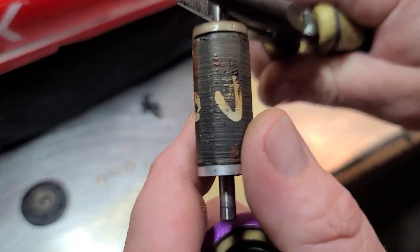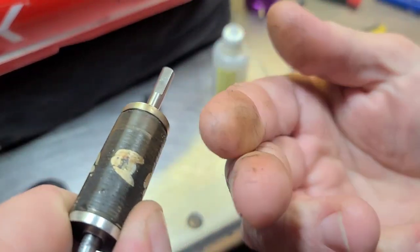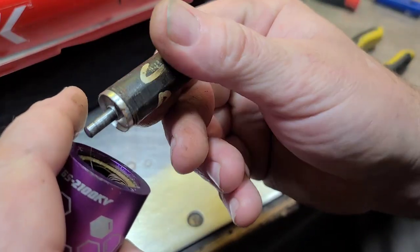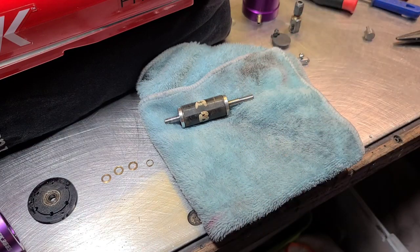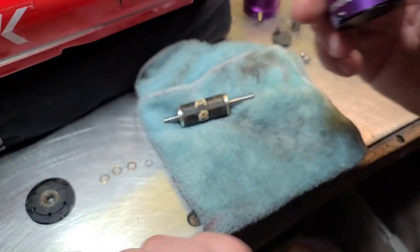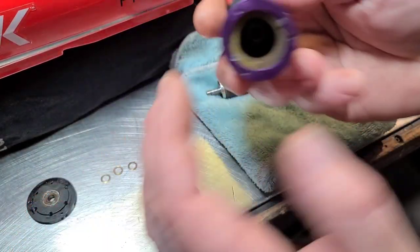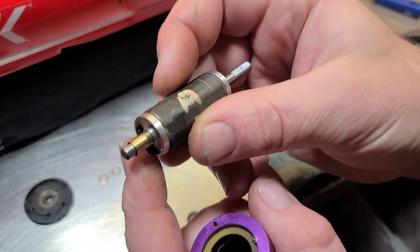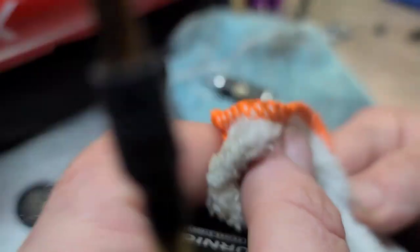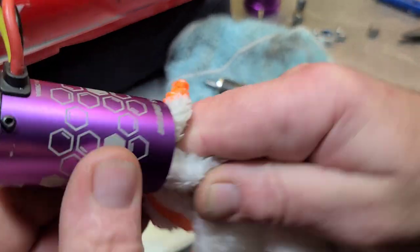It's pretty dirty — there's some rust in there, probably from sinking the boat today. Water got in the motor and rust got all over the rotor. Lay the rotor on something non-metallic. There was one big shim that came out the back of the motor — that big shim just sits on the back of the rotor, then you put it back in. You'll lose RPMs and speed from all that buildup in your brushless motor, so anytime you sink it, always do this.